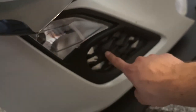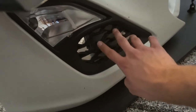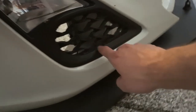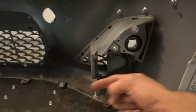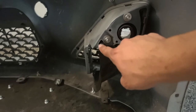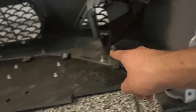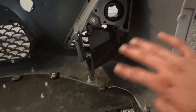The second thing: the FR-S front bumper has these vents, but normally they don't actually have holes unlike mine. You can buy vented ones with actual holes for about $70 from 86 Speed, or you can just cut them out like I did — it looks a bit rough but it works. Air now shoots in through there, but it was hitting the wheel deflector cover rather than the oil cooler. So I took the air deflector piece we removed from the front grille and zip-tied it right at this opening so that air flowing through the newly cut vent shoots toward the oil cooler. I zip-tied the top hole, used an existing hole on the side, and drilled one additional hole in the plastic for the bottom zip tie — it's holding on really tight. I'll have a track day soon and I'll report back, but I doubt it'll come off.